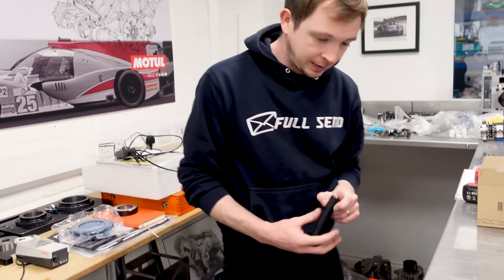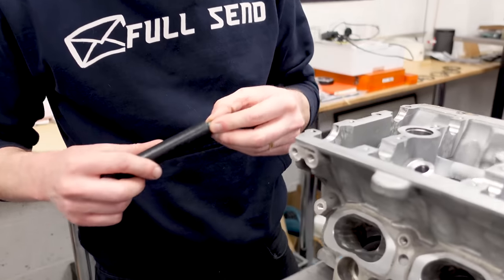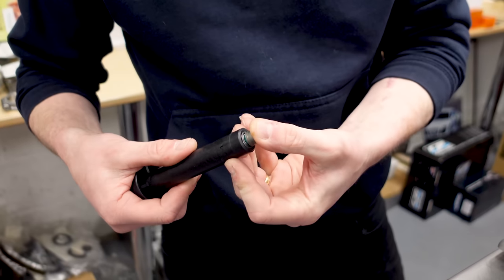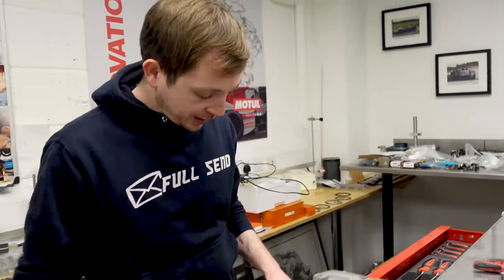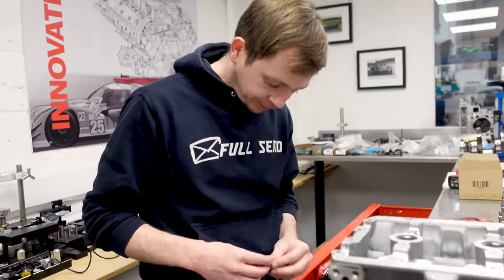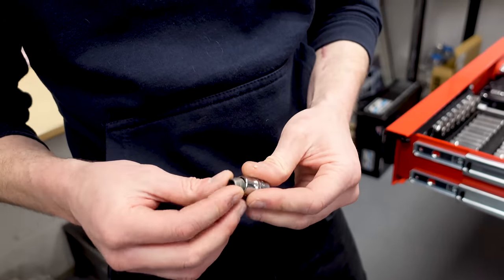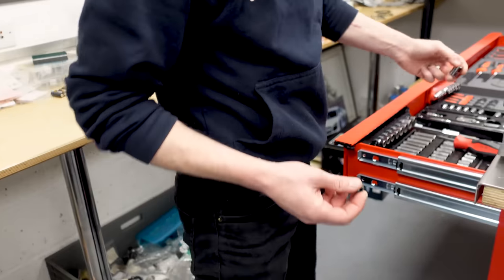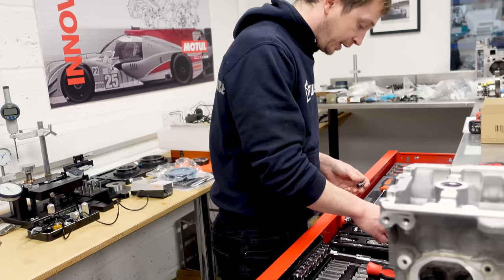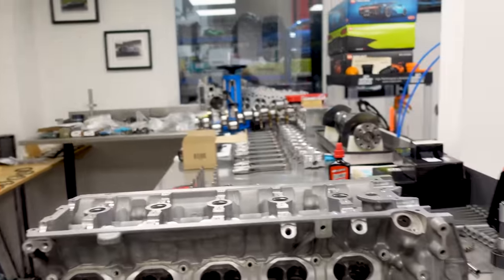I have a special tool for pushing valve stem seals in, but it's rubbish - it wants to force the spring back, it doesn't sit in there nicely, so I never use that. What I use is a double hex socket that doesn't touch the seal - it just touches on the edge. It's sort of like the roundest thing you can get. I use a little extension and then assembly lube. We don't go in dry in this establishment.